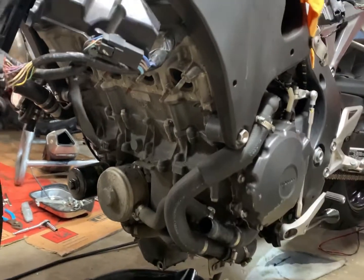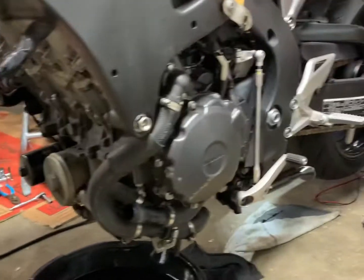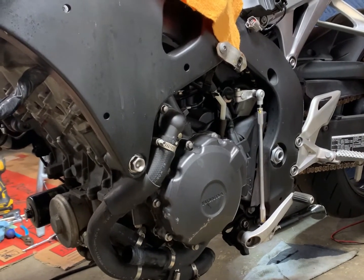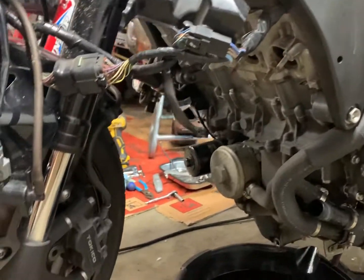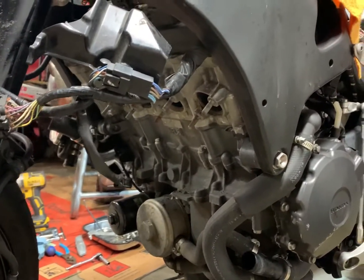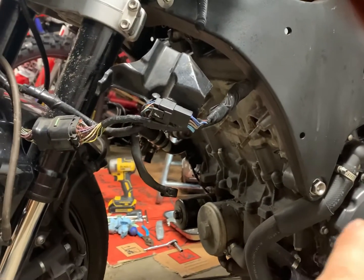Drain the coolant. And since there's motor mounts right here, and right here, we got to take off the chain still. So we'll take that cover off and then take the sprocket and snap that bolt loose and just unhook the sprocket right there from behind this, and that'll undo the chain. And then take these bolts out. I don't think we have to move anything else. We might need to take off that hose because it looks like it might kind of rock forward a little bit and then drop, and I don't want to mess up that coupling, so we'll take off that hose right there.